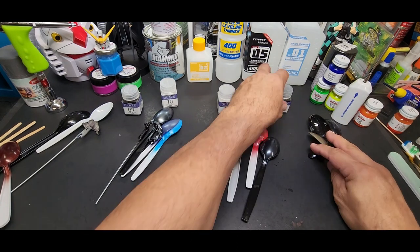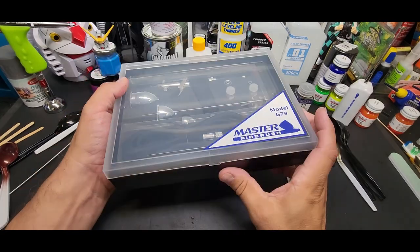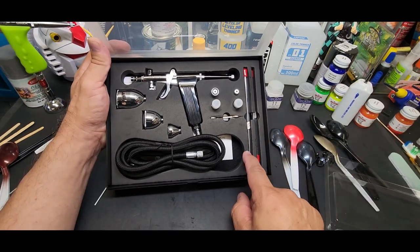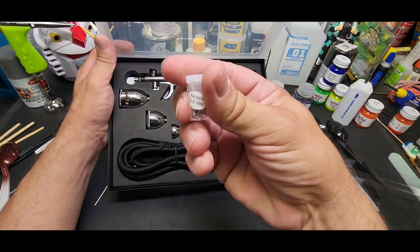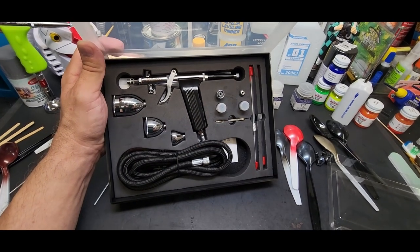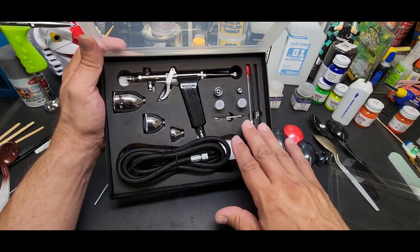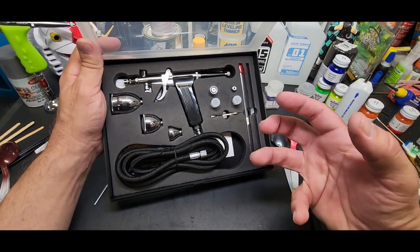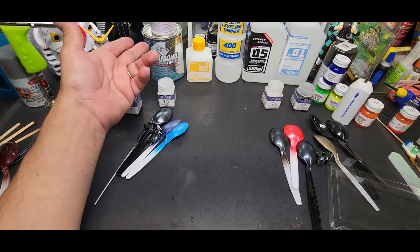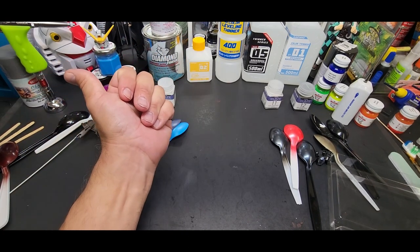This came in today — check this out. This is under 70 bucks. Three needles: 0.3, 0.5, and 0.8, and they give you the nozzle and the caps. It's a trigger type with a MAC valve, three cup sizes, came with a hose. I'm hoping this is good — really good value particularly with the 0.8. I've been trying to get a thick fat needle so I can paint some of my car paints and test this Diamond Finish. I think it needs xylene-based thinner — I ordered their thinner, that's coming in.